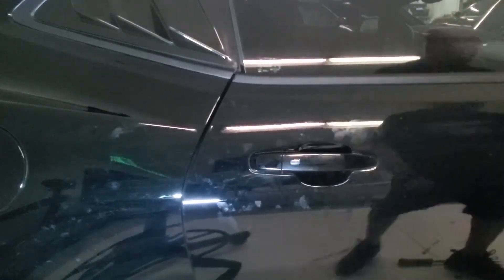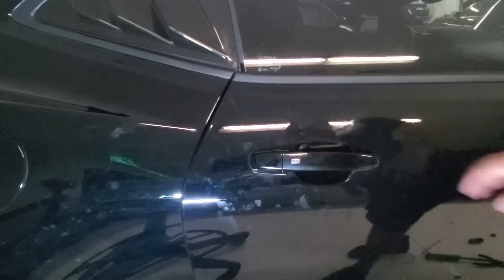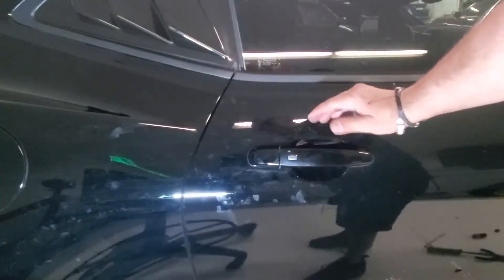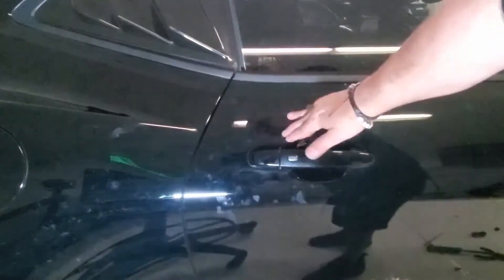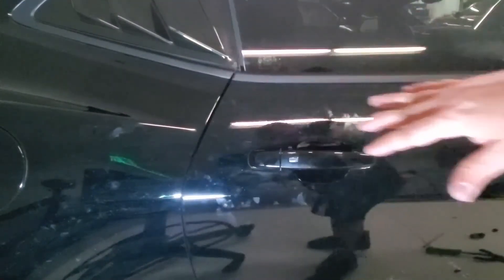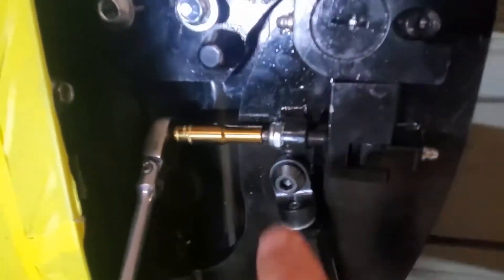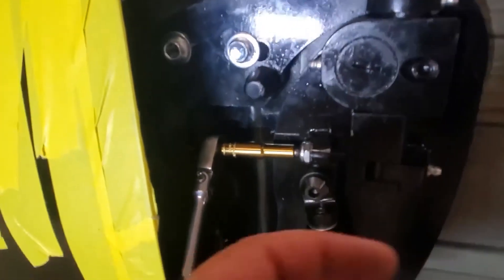I took the wrench and tweaked the bump stop bolt just a little bit to bring the door down further, then unlocked the lock nut and made a small adjustment — about a quarter turn more — and the door seated perfectly in the latch. That adjustment bolt goes in on the side and when threaded in, it takes the back end of the door and raises it up.